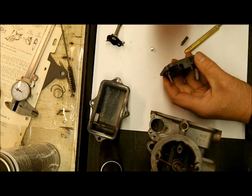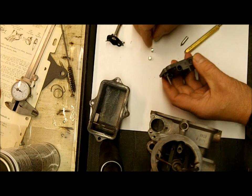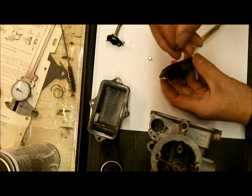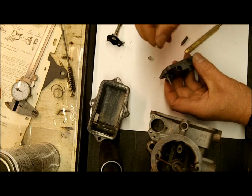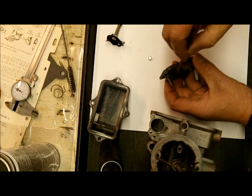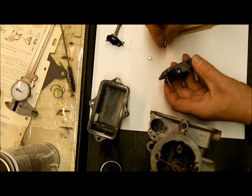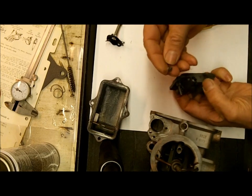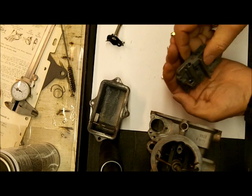You've got these little plugs — which I'll be including in all of my Holley 1920 carburetor kits. You'll need two of them to plug off these holes because you've drilled them out. You won't find these in any other kits out there; they'll be exclusive to my kit at no extra charge. Put the plug in the hole, get it lined up, and tap it in. Of course you want your check weight in there first — that's what keeps it in place.